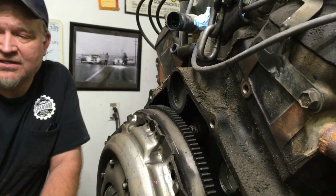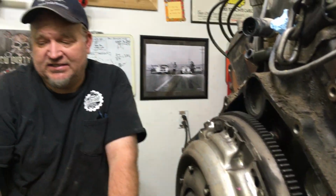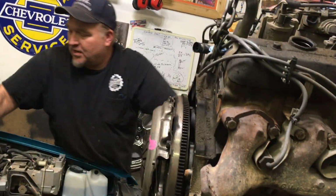What I do is I'll break them loose with a wrench at that point, both of these, because these are both tight against that firewall. This one's easier. This one's not as easy. So jack it up. So at that point, your engine's gonna be tilted like that. Your firewall's gonna come away from it. So then I get a hand wrench from up here, right through here, and I'll start undoing it. Then I grab my gear wrench right there. 14mm gear wrench. Throw that dude on there.